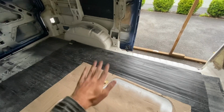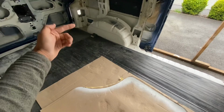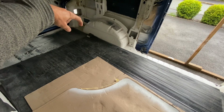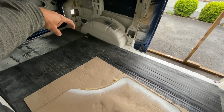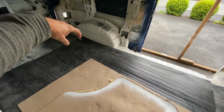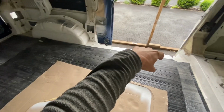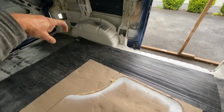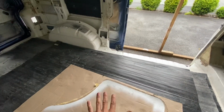So there's two ways I could do this. Put the ply down on the floor here, it almost just about fits inside this gap, and then scribe it in, keeping a ruler or a piece of wood with a pencil on it at 90 degrees to the wood, and draw around, following it around, and then end up with your line drawn on your piece of wood. Have to keep it at 90. If you turn it, well, you've ballsed it. Jigsaw that out and it'll slot in.